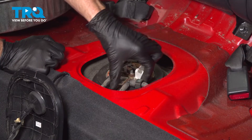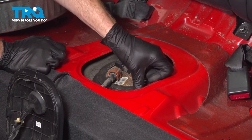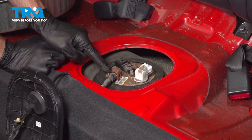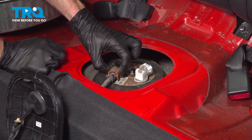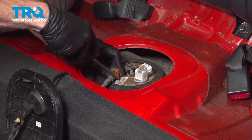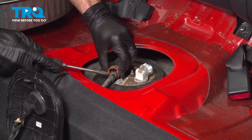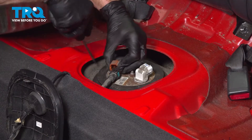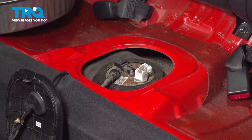This fuel line with the green tab connector here, you can just push right out of the way — we don't need to deal with that. The next fuel line that comes up along this area has an orange locking tab that covers up the tabs we're going to have to squeeze to remove this. We'll carefully pry this out of place — we don't want to break it because we are reusing it. A quick inspection of that locking tab; just inspect it and set it aside.